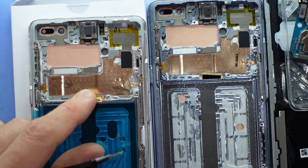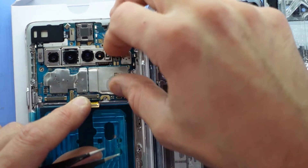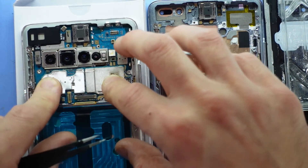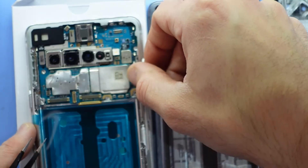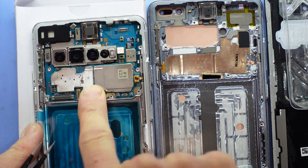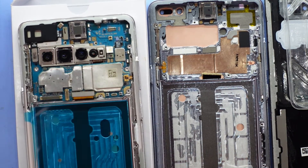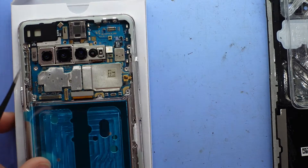Now I should just be able to drop this in, wiggle it slightly. This needs to fold over — push down on the display, wiggle it into position, then push down. It should make a noticeable snap kind of noise, and hear that — it's typically it moving into position. The old frame — don't need it anymore, it's done.